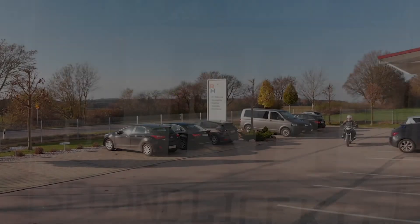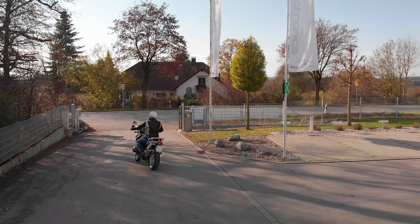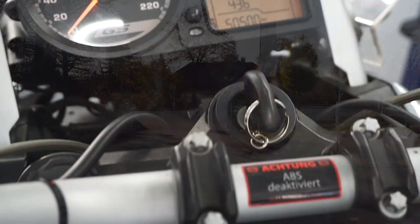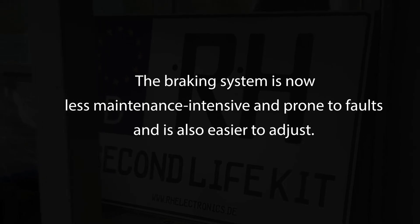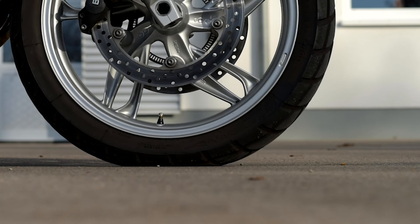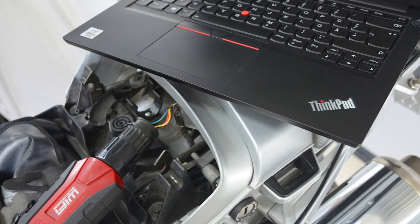You can now reassemble the motorbike and carry out a test ride. The braking function on the front wheel and rear wheel must be clearly demonstrated. Please note that the power-assisted braking and ABS function are no longer available. The braking system is now less maintenance-intensive and prone to faults, and it is also easier to adjust. Please note, however, that both wheels can lock during emergency braking because you do not have the ABS function. When using a diagnostic tool, the ABS control unit is no longer found or can no longer be accessed.